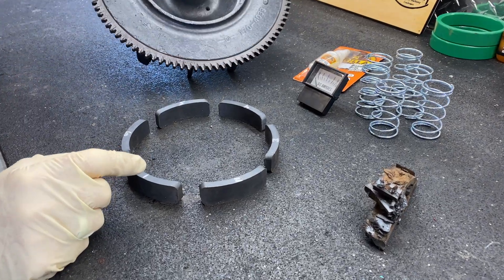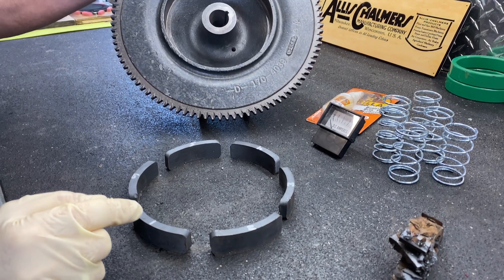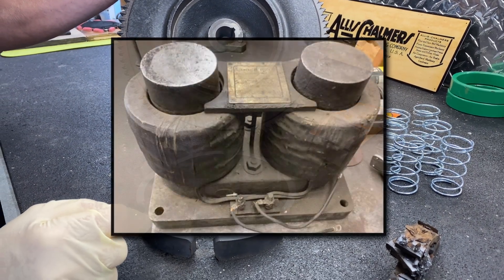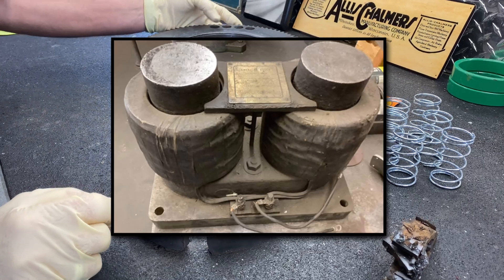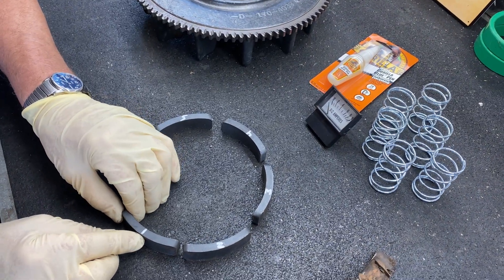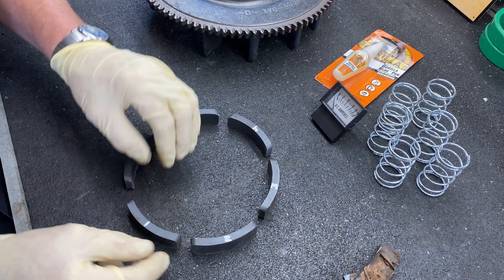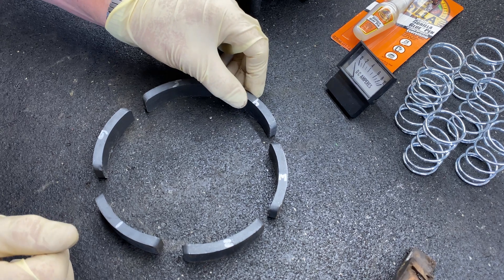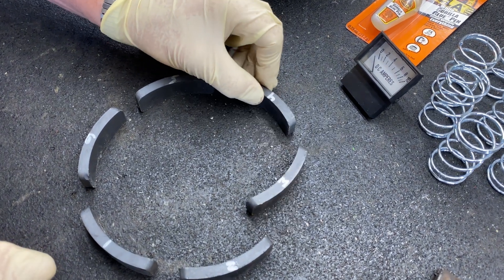The customer supplied us with these magnets that he bought and we went ahead and magnetized them with our magnetizer. We've got them numbered and they're ready to put in. And if you notice, they oppose — and that's what you want them to do. You want the ends to oppose one another, and that would be your north and south pole on the charging system.